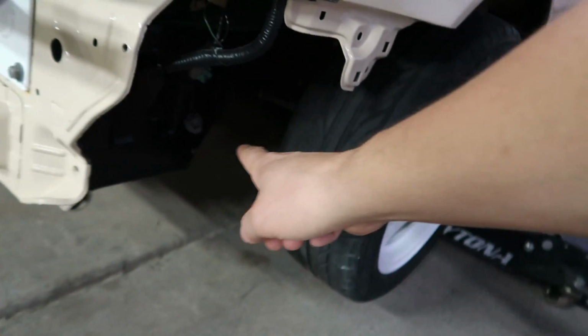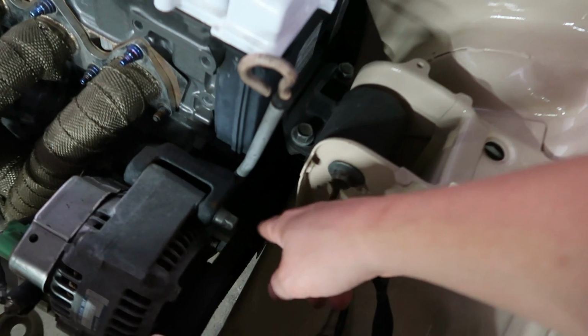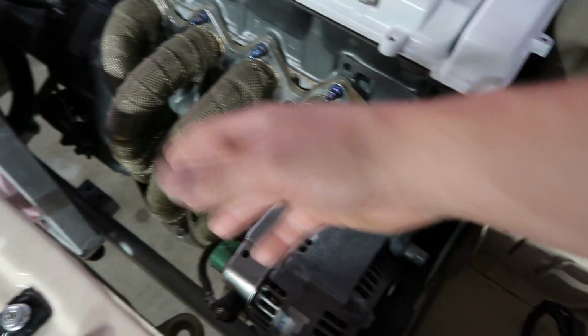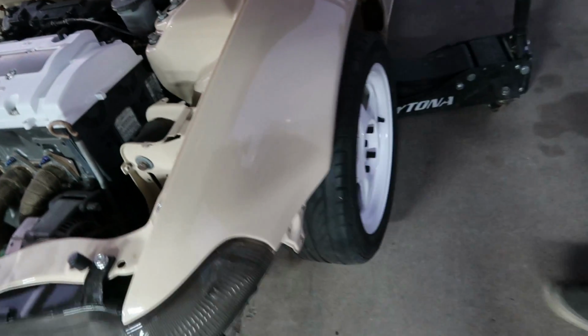And while I am doing that, Braven is getting the Integra ready to maybe do a little drive really quick. If you don't know, the radius arm isn't on this side. We still haven't gotten a custom radius arm that clears the crank pulley inside of there. So the stock radius arm, or the one that comes for the DA with this traction bar, actually hits the pulley because the F20 is just such a larger engine. Ooh, you better be careful not to scratch them wheels, boy. Yeah, he's gonna get that radius arm put on so we can do a little drive. It doesn't rub immediately, it's if you hit bumps or coming up the curb. All right, here we go.